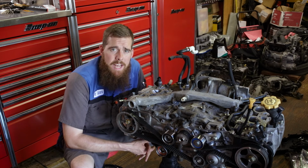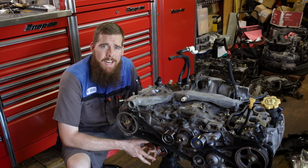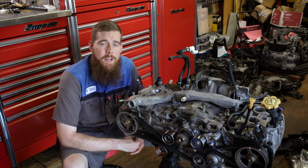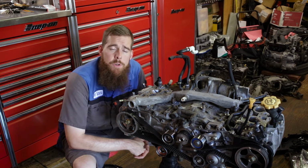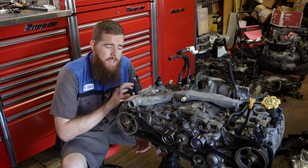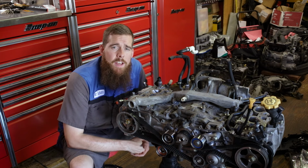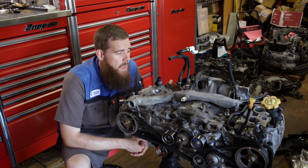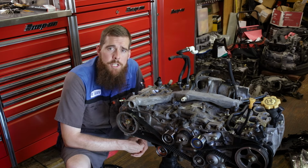I know a lot of people have asked for this video in the past, and it hasn't really been convenient for me to film it, so we might as well go ahead and do it now. Anytime that you do a head gasket replacement, remove the cylinder heads, remove the rocker arms, or do anything in that area, it's always a good practice to go through and adjust the valves, or at least check the valves to make sure you're still within specification. So we're going to go through that procedure now.